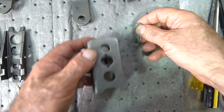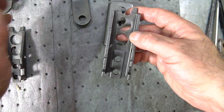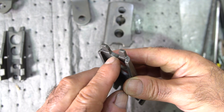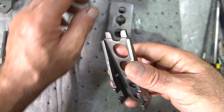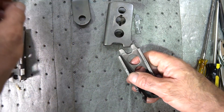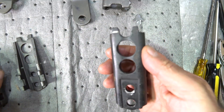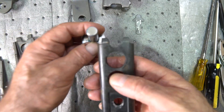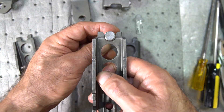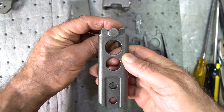The select pin, reverse plunger, and carrier are all done. Now, on some of the straight receivers — the ones that don't go over to the side — these receivers tend to have a sharp edge that doesn't have a nice smooth contour. When the plunger fits through it, it's not seating correctly. I use a stone to deburr them. Here are some older receivers from the 70s — the contouring is nice and uniform so the selective pin fits in perfectly. The newer unfinished one doesn't seat as well, so I deburr it for a better fit.